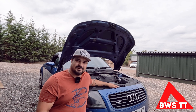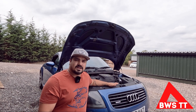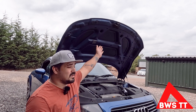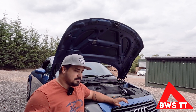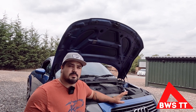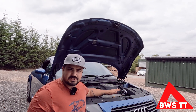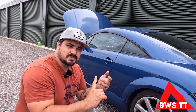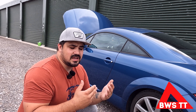Sorry about the tractor — this is the only time I've got. Cooling wise, there are a few things we can do that are nice and cheap. The first is cutting a big hole in the bonnet to allow all the hot air stuck inside to get out. We can put an oil cooler on there — it isn't massively expensive but it is a little bit, so I'll weigh up the options. We can also add water-meth injection which is going to help with air intake temperatures. Suspension-wise, I'm thinking either a good set of coilovers or at the very least freshen up what's there — but I think it needs to be stiffer to deal with the big compressions.